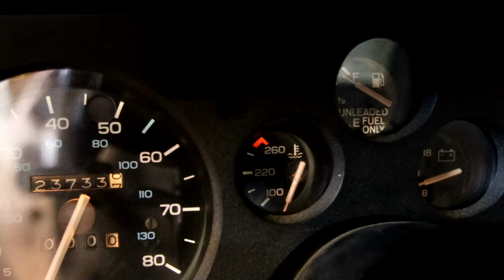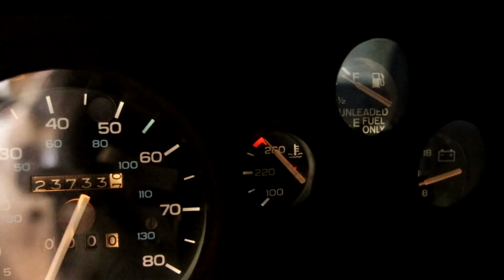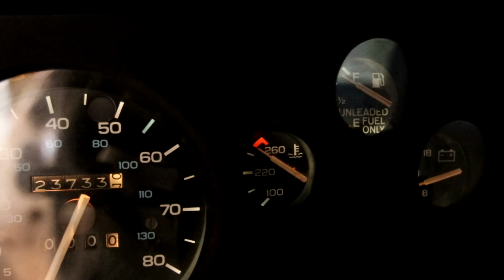The reason I'm doing this is because I wanted to test the sensor before I actually swap it, because you've got to dump the coolant out and all that. But I've got heat on it now, right on the tip of it, with this little propane torch. It's probably pegged almost. It's hot. So I've got heat off now, and you'll see the gauge start dropping back down. So that tells me that this sensor is probably going to work for me.